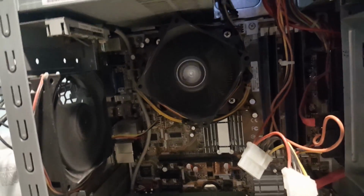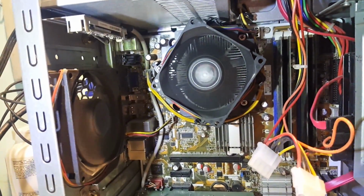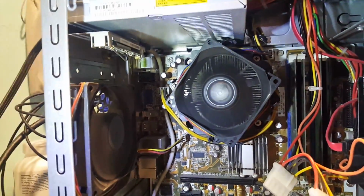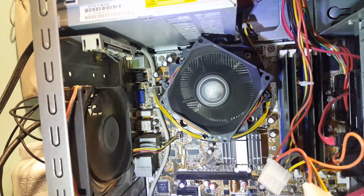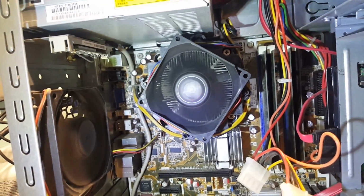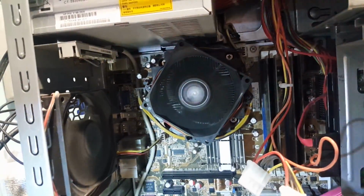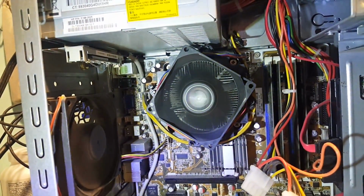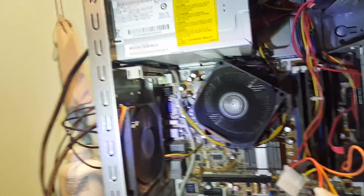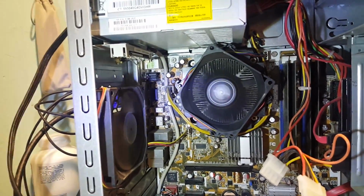And since the CPU is going to be changed out, another thing I want to do, I'm pretty sure this board is capable of it. There's a secret engineer's setting in the BIOS where you can actually mess with the fan PWM. You access the BIOS on this with F10, I believe it is. It's usually done by holding down the control key while spamming F10, and that should get you to the secret settings in the BIOS. If you don't know what I'm talking about, well, Google it, YouTube it. It's on there. If I remember right, because I've worked with this board before, but God, it's been so many years, you can absolutely do that, and that's what I'm going to do.